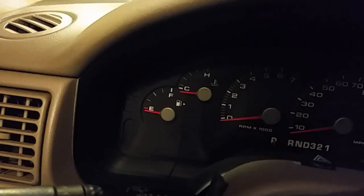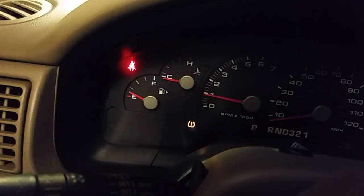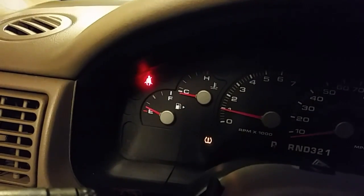So we got this plugged back in. Let me roll out of here and go back upstairs. We'll start it up and see if the four-wheel drive flashing light is fixed. If we start this up and this helps the condition — well, I hope it does. The motor seemed okay; I didn't see anything bad down there, no leaking or anything like that. So we'll go ahead and start this up. The four-wheel drive flashing light would be right about there. Here we go. Whoa — how about that! I can't believe it fixed it. That ground wire apparently just broke off; it had all that corrosion on it. Apparently it's a very common issue with these Explorers, and I think even the Expeditions.